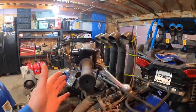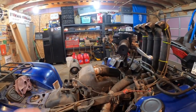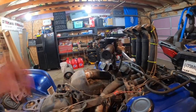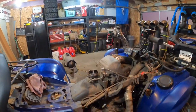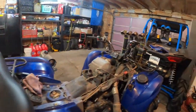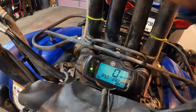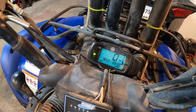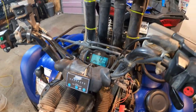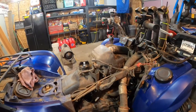What did I just break? It felt like a throttle cable. So I decided to try starting it again — did the same thing. Started it up, bang bang, cracked, shut off. So I ratchet strapped it back down, left it on the trailer, got home later that afternoon, pushed it off the trailer into the garage, turned the key on, and right here there was a number 15. Throwing a Code 15 and the check engine light was on without even starting the engine. I shut the key back off and Googled Code 15 — Code 15 is a throttle positioning sensor.